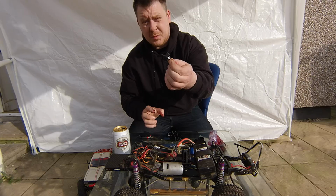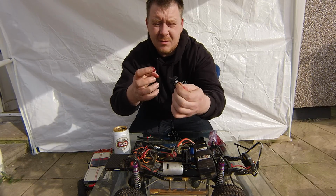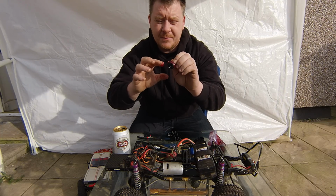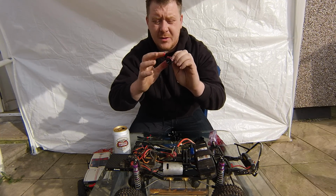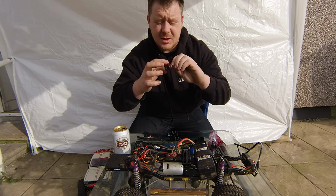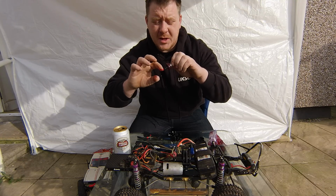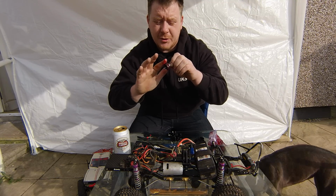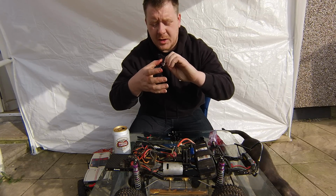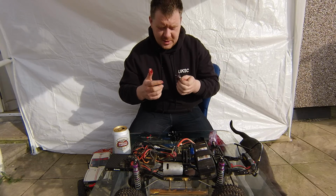and then pull out your diff gear, or the main locker at the bottom, and just slither it all around that. If you want to use a syringe to do it, you can. You can do it whichever way you want, but either way, make sure you get a load of grease on the bottom gear. You don't want to put so much on that it's going to start binding, but you need enough on so it coats around all three sets of gears.